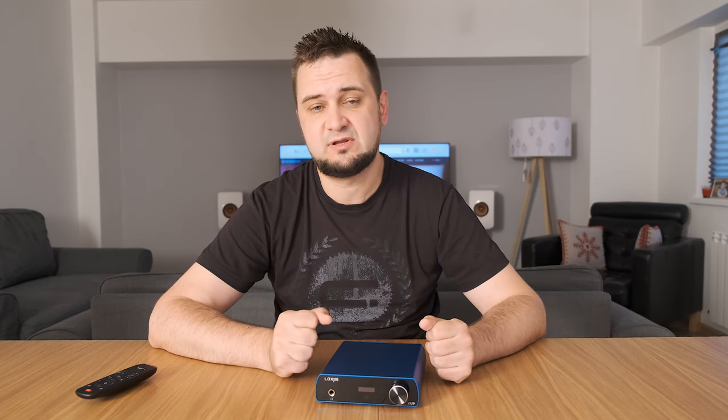The headphone amplifier is quite modest, offering only 220 milliwatts of power at 32 ohms — more than decent for a portable device but not a lot for a desktop solution. The headphone out has 40 digital volume positions but doesn't offer a gain switch. For my IEMs I'm somewhere between volume positions 8 and 15, and with full-sized headphones around 30 to 35. The headphone out is there mainly for convenience and will not outperform a dedicated headphone amp — it sounds pretty good with dynamic headphones but is not really impressive with planar magnetics.